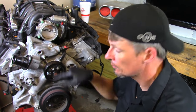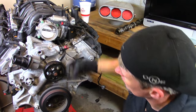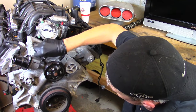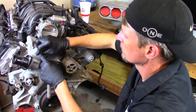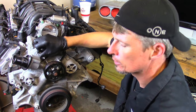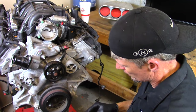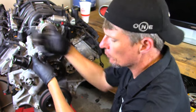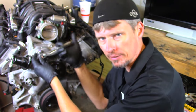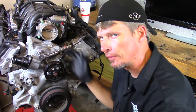Keep filling the bottle up. Once you get coolant coming out of the port, put a little thread sealant on the recessed Allen, go ahead and put it back in its threaded port, and snug it down by hand. Then you can adjust the level in the coolant bottle, fire up the vehicle, and make sure everything's okay with no further leaks. Over the next couple of days, preferably in the morning when the engine's cold, go out and check the coolant bottle to see where the level is.